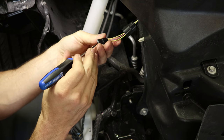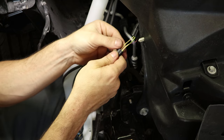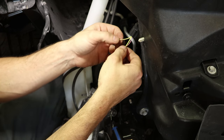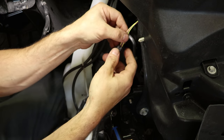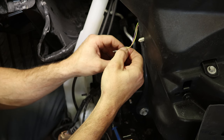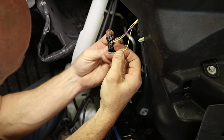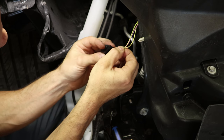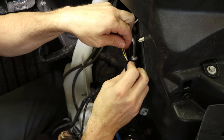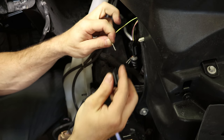Slide the back of it back — that's actually the part we're trying to change. Unfortunately we have to take the rest of this off to get that out. We'll pop the pins out of there and take the center of the plug out. Take the little gasket off. Now we can get to this outer piece of the plug. The pins are just the exact same size — you've got to get them just right before they'll slide out of the hole. There's our two plugs. You can see one tab is broken on the other one — that's why it wouldn't stay in. I'll take one pin out at a time, put it back in the other plug in the same place. Make sure I don't mix them up. Just keep disconnecting our wires one at a time and putting them back in the other one.